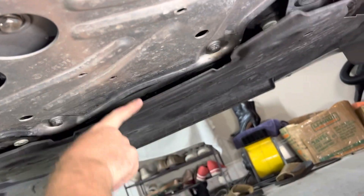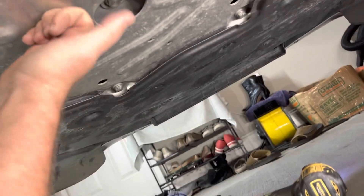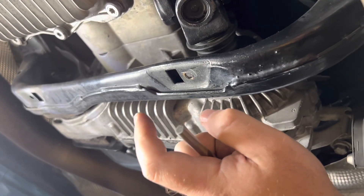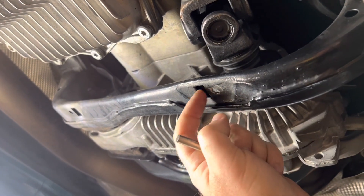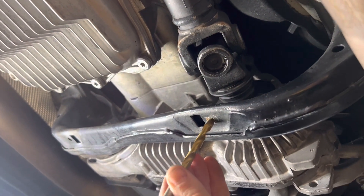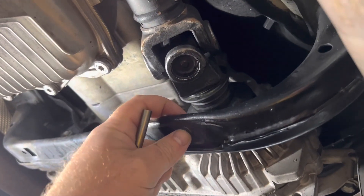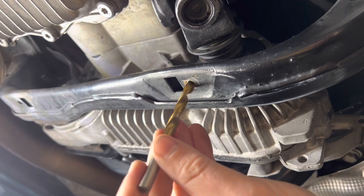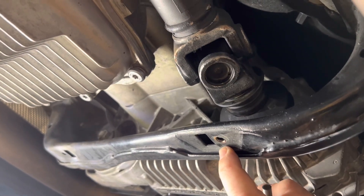This will add some clearance to the metal splash shield. On diesels and other cars there might be a metal clip that slides through here — you'll slide that out. The F85 doesn't have that; it just has a factory hole. Then use a 5/16 drill bit and drill all the way through. It's already a straight-through factory hole — you just have to enlarge it slightly to 5/16. Once that's done, you're pretty much ready to install the shield.